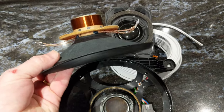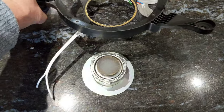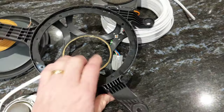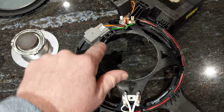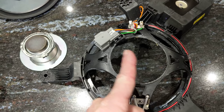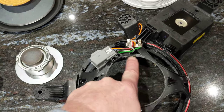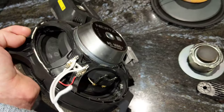Pulling all of this away, you can see those are the two connections on the back that were soldered in. Those come away and represent the two channels on the amplifier. Then, to get the magnetic coil or the magnet out of the frame, you have to cut it out. On the back — if I flip this one over — there is a small dome of plastic. The first step is to cut into the top of the dome to release it, and the second step was to cut around the edge.